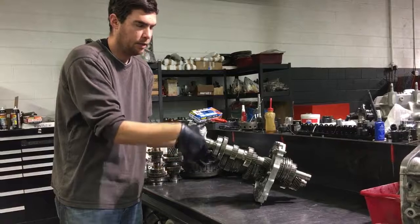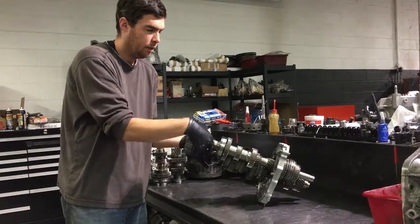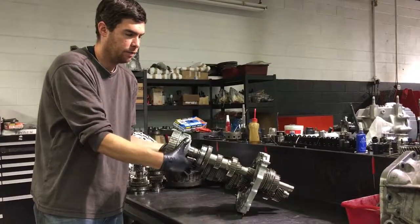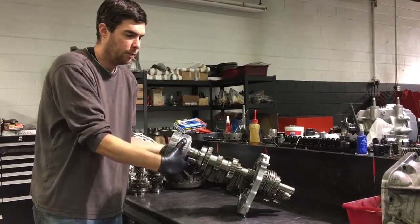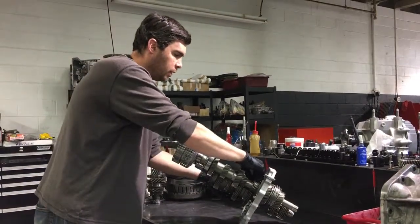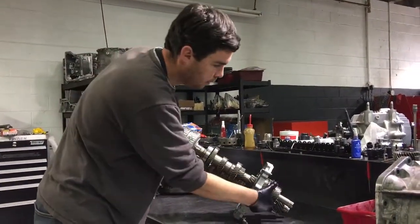If we have the car in normal mode, you can see that this basket is moving faster than this one because this one is still engaged in first gear. In normal mode, it always has the next highest gear selected, so it'll pull out of first gear and then engage third gear.